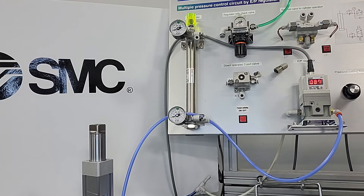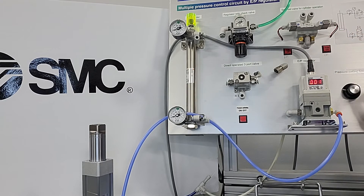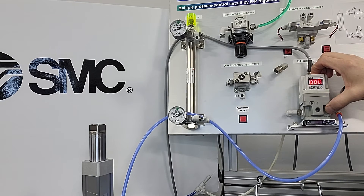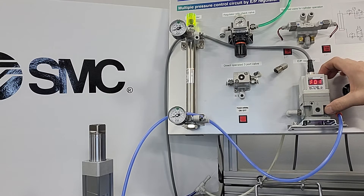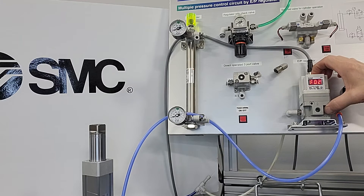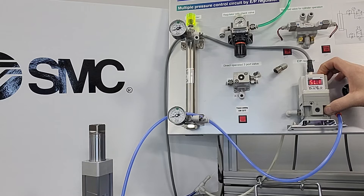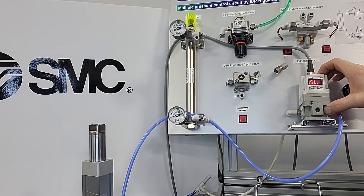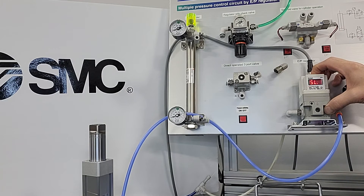Some customers do not like that. If you press and hold the set button — I'm going to turn this off — if you press and hold the set button for two seconds you'll enter the function menu. Arrow up one time to the sensitivity level. Press the set button once to select and then increase, or make the sensitivity more dull. Five is the highest setting. Press and hold to select that.